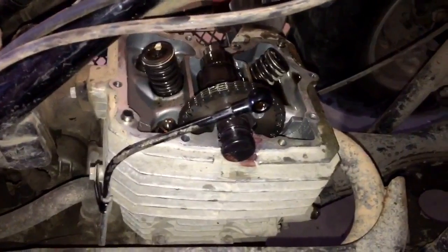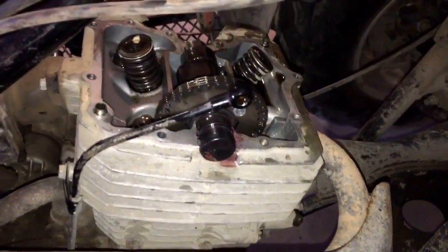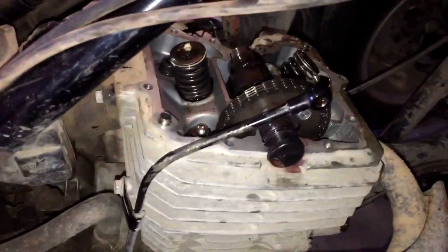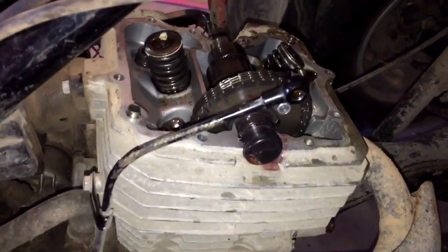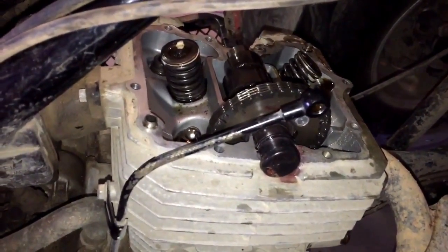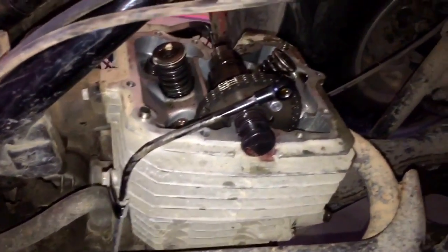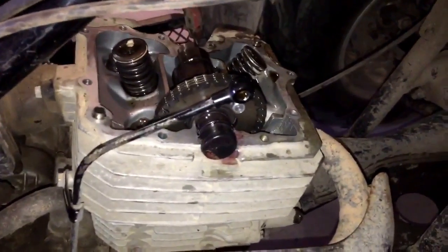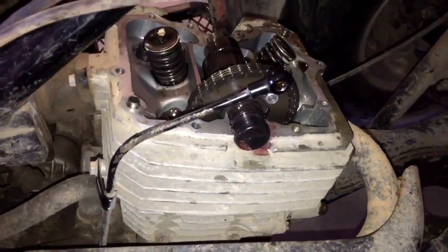So I've got the Big Red camshaft sitting in there. It was super easy to retime it because I didn't let the sprocket come off the chain and didn't rotate it at all, so it pretty much kept in time. You've basically got a 50/50 chance of getting the bolt holes right and I got it right on the first try. The camshaft could be flipped 180 degrees out pretty easily, but at TDC the cam lobes are up — she's good to go. I'll clean up the gasket surfaces, use some spray-on gasket, and then adjust the valves to Big Red spec.